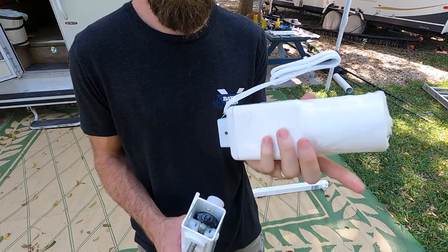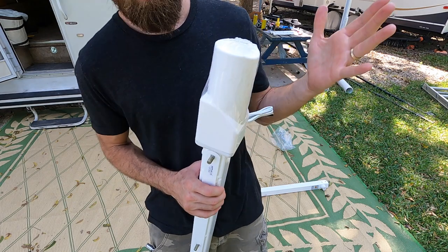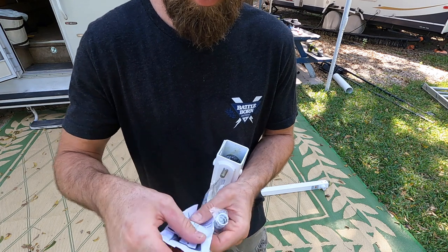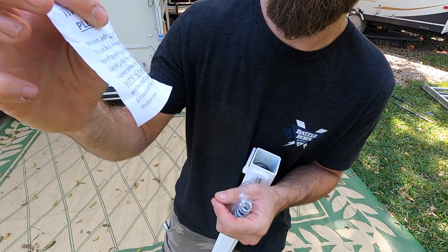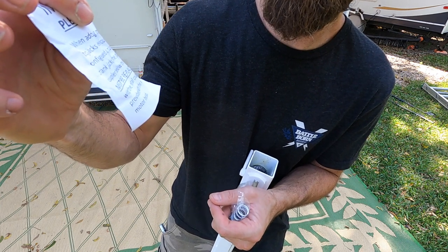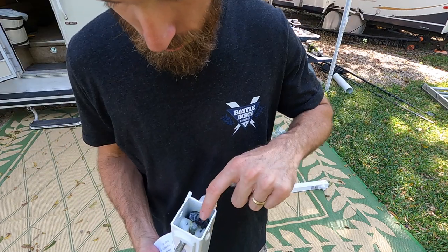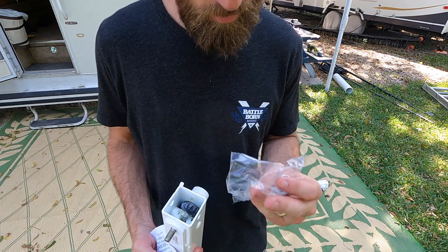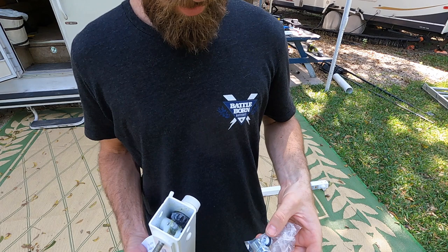You gotta get this motor for the leg onto here, like so. But first, it helps to read the instructions. It says here, when adding motors to jacks previously configured as manual crank jacks, the plastic coupler below the cap must be replaced with the metal coupler provided with the new motor head. So there's no plastic coupler at all. I bought this kit a little bit differently than they normally have you buy it, because it saved me about $300 and all. Link in the description to that.